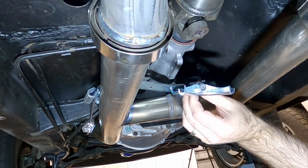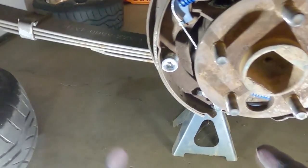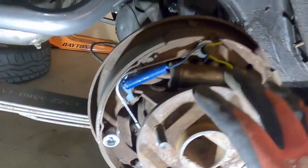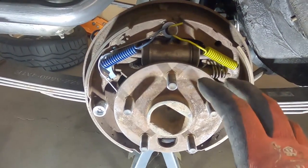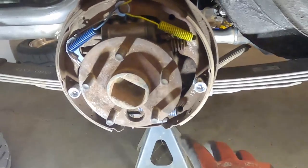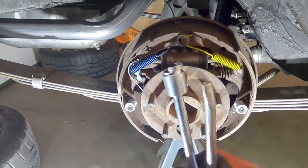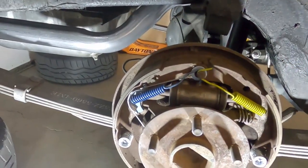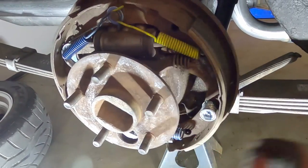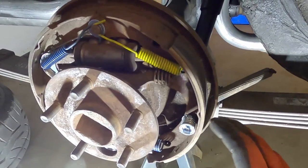On mine, this is where the parking brake cable is supposed to come in, but mine's cut. We need to get all this out and get to this lever behind the drum shoes — that's how the parking brake cable attaches. You'll have to disassemble the whole rear drum system. If you're unfamiliar with this, take a picture of everything now — there's a specific place for each spring and different shapes. There are tools for taking off the little spring caps and for getting the springs off using their shaped ends. These are install-once with little tabs on the back, so I'll have to basically ruin the old system to get it out, but that's okay because the new parts have everything we need.